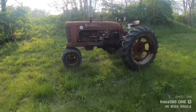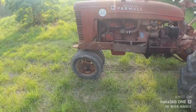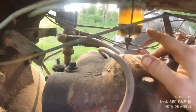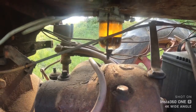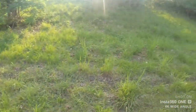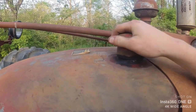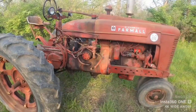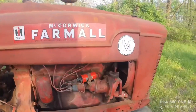First thing I always do is look and see if the fuel is on. If somebody left the fuel on and you've got a bunch of sediment like this one here, you're probably going to have a fight on your hands because it probably means your tank's dirty. Either way, you look in the tank to see if you've got nasty fuel, rust, or whatever you have to work with.